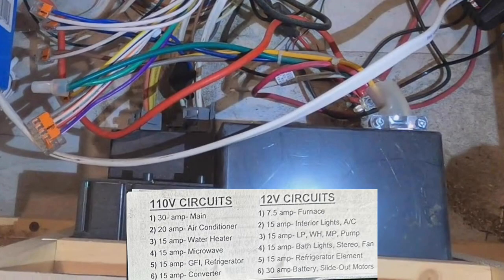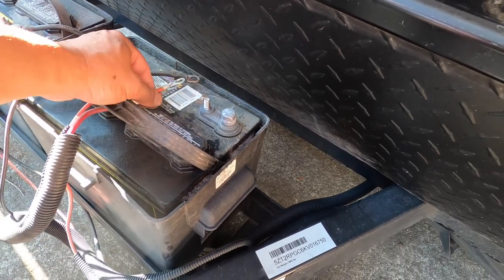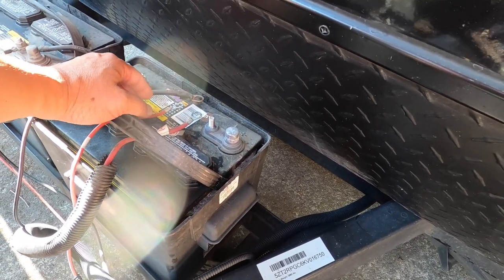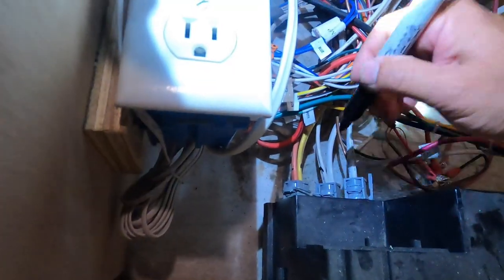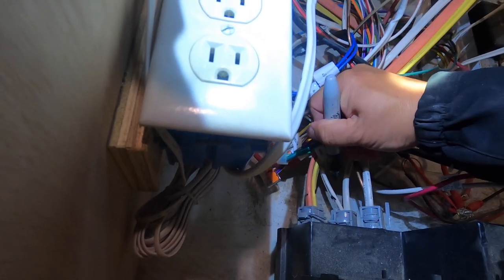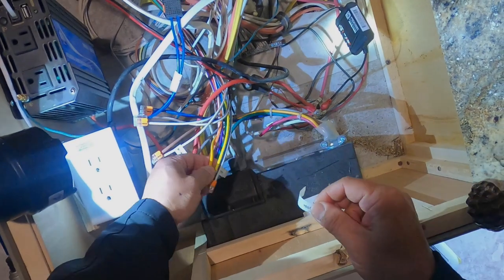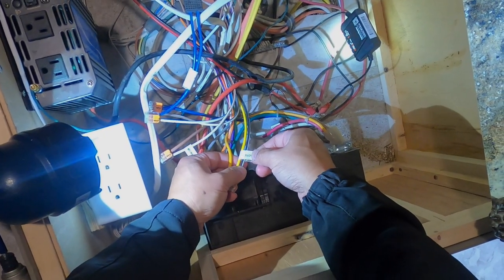DC electrical circuits enter the power center on the right side. This is a bundle of color-coded wires: red, white, brown, yellow, gray, green, and blue. These wires power things like Tom had mentioned — the lights, vent fan, water pump — and charge the RV battery. Before disconnecting anything, first unplug all electrical supply to your trailer: that means the battery and the shore power. Another good practice is to take pictures of everything before you begin. Here I'm labeling all the AC wires with a Sharpie, noting the breaker to which they are connected, and then I labeled all the DC wires with the corresponding color wire from the power center.